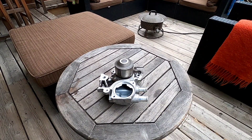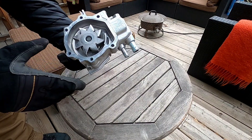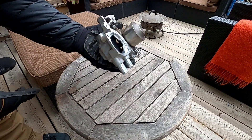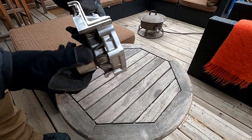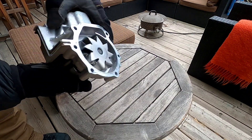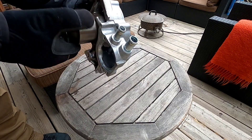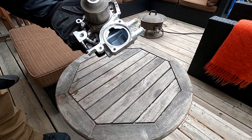We're back with all our COBB parts and bits and bobs from Killer B and IAG back on the Subaru. We're going to show you some of the parts that came off the Subaru before showing what it looks like after. This is the water pump that came off - it actually looks really nice, very clean inside, still looks really good. But when you're putting a timing belt system back together, you might as well put a new one on because it's not that expensive - about 100 bucks versus all the work and possibly messing up your engine.